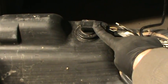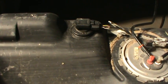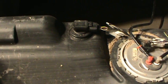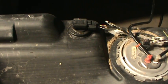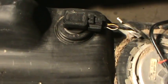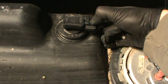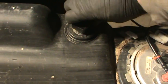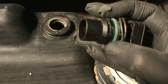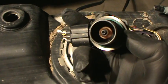That's what it looks like. This particular vehicle is a Ford — they all pretty much look the same. It's a three-wire sensor and it works pretty much the same as a throttle position sensor. You got the power, the ground, and the signal wire. The power is not from the fuse; it's a five-volt reference. This is how you unplug it — just push down and pull it out. This is how you undo it from the tank itself. You got an o-ring to help it seal, and if that o-ring goes bad, you're going to have an evap system leak.